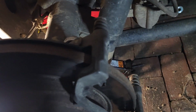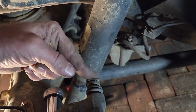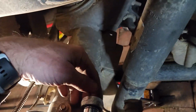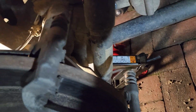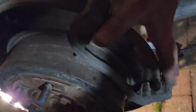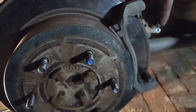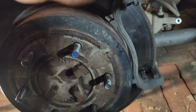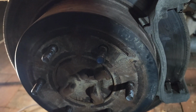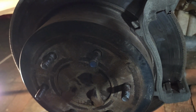We've got some lights. Now I want to show you how this thing gets disassembled. So the first thing you've got to do is take off this nut which holds the floating caliper on, and then you take this thing off. You take the floating caliper off here, and the next thing you do is these bolts at the back, these big ones, you literally take those off, and this whole thing comes off. And then you just tap the disc here, knock it back and forth, hit around the drum, and the whole disc brake comes off. And then inside there you're going to see